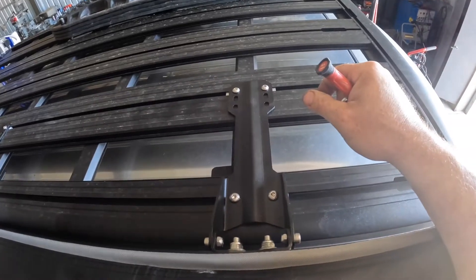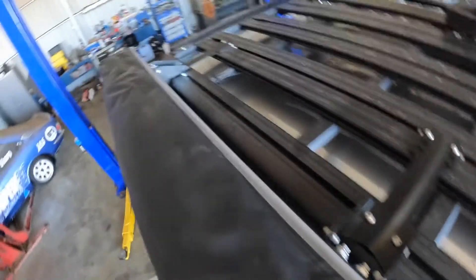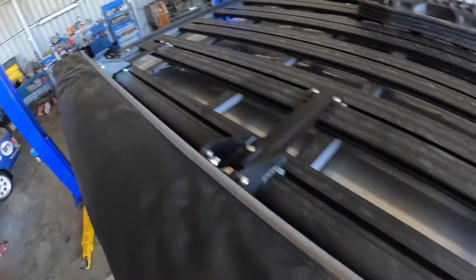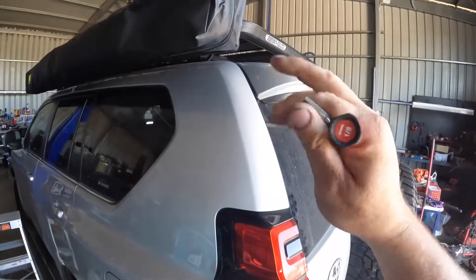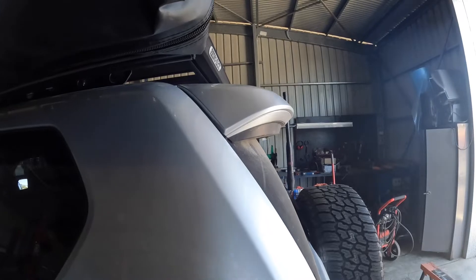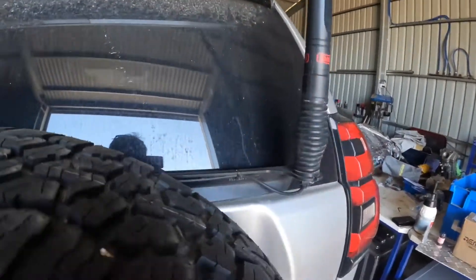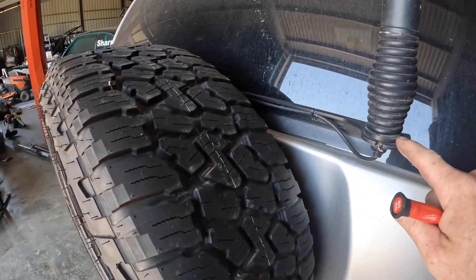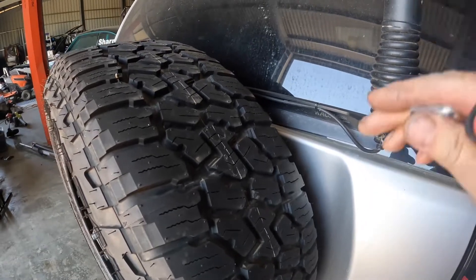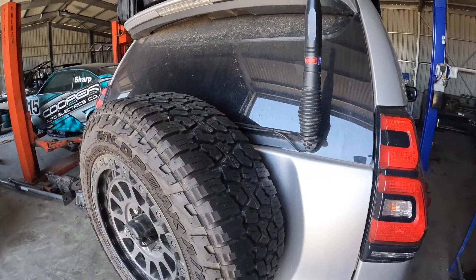So this is how the brackets have worked out — they just fit perfectly across two rails, and then the last one up the front. I've left these tight but not super tight. I'm going to pull this out and see where the actual rear bracket goes across the back, then adjust it forward and backwards to suit. I also need to check whether it clears this antenna mount on the rear. Worst comes to worst I might just have to make a small step-down bracket to allow it to clear for this trip.